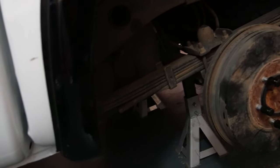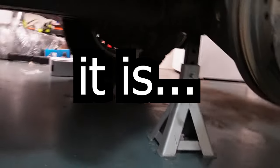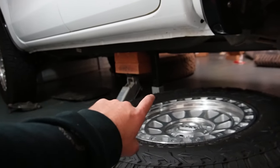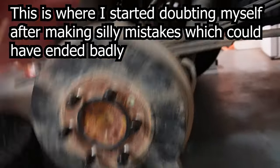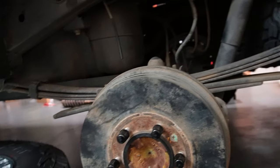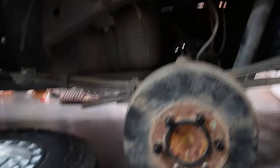I had second thoughts about doing this — once I take that out there's nothing attaching this corner of the vehicle to the actual chassis. So if I take that off, is this not just going to come down? So I've got two stands on the back. I was right — if I had kept going, this whole side would have just come down. So we've rejigged it. I've got it sitting on the jack stand up here that's not holding the weight at all, and I've got the jack stand over here ready to catch the axle as it comes down. So now I'm going to take the shock out and the springs out — this should just sort of come down gently onto that and we should be able to put the new stuff in.